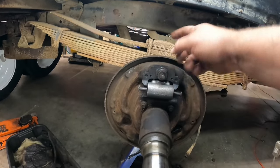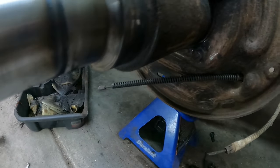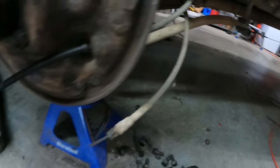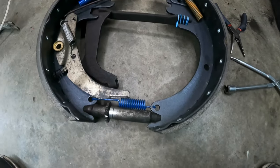Hooked up the line on the back side. Driver's side I'm going to have to actually fix that since I broke the line. I did find my parking brake cable and just laid it in place - I didn't worry about taking the other one out right now. I went ahead and opened up the spring kit hardware. I took all the pieces I needed to reuse over to the bench, cleaned them up, scrubbed them real good. I hit the contact points with Scotch-Brite just to make sure any build-up that would cause them to stick was removed. Then I went ahead and assembled the drum brakes - you can see we've got the adjuster in here run all the way in, the spring hooked up, and the adjuster stop with a new bushing.